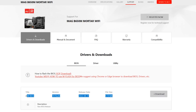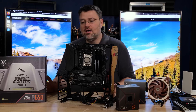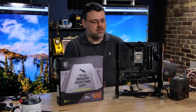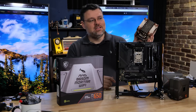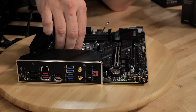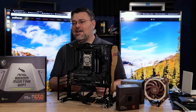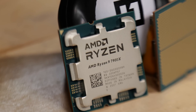As always, the first thing you want to do when building is update your BIOS — even if it boots fine, updating brings quality of life and stability improvements. AM5 is a cool platform because pretty much any AM5 motherboard will run any AM5 CPU, including the monstrous 7950X. I was able to cool it on this motherboard with a Noctua dual AF-12 tower cooler — not even as beefy as the NH-D15 — and it didn't really throttle. The 95°C hotspot on AM5 was kind of overblown; it's a set point, not a throttle point. There's no actual throttling occurring at 95°C — that's just the target for maximum performance.